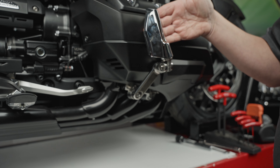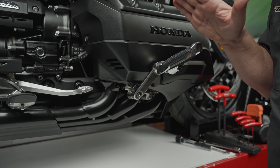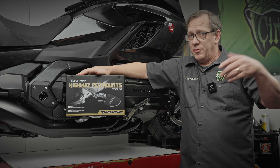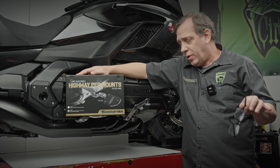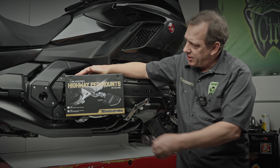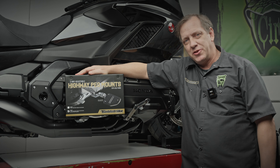You can see it folds up without hitting the engine. This whole unit can slide back and forth with the two bolts underneath. For right now, that is how you install it. The other side is just like this one but using all the left-hand parts. There really isn't that much to it once you take it step by step. If you want to see more about the fitments and what this thing can do, go to goldstrike3d.com and type in the three-way adjustable highway peg mounts. I'm Ken with GoldStrike — I hope this was helpful, thanks for watching.